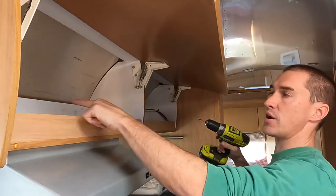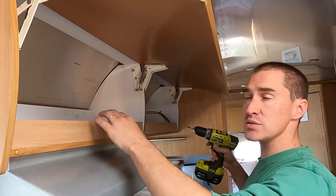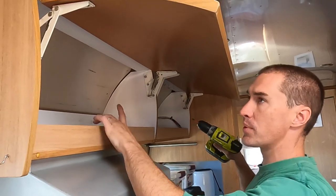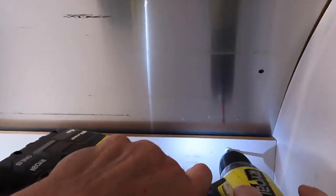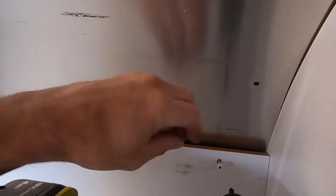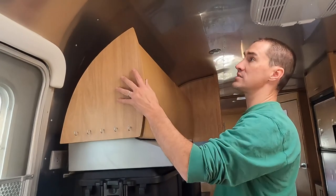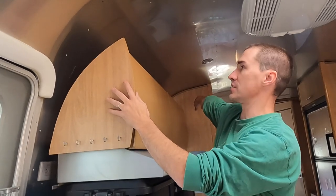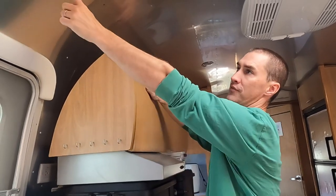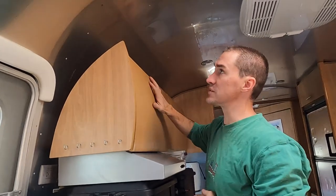I'm trying to get away with not undoing any electrical either. I can see 4 screws across the back and 4 screws attaching across the top. It's possible there are more screws I can't see, but I'm going to start with the first 8 that I can. There were no surprises — it really was just 8 screws holding it on, and there was nothing holding it to the next one over. So I've got my rivet line exposed and I'll be able to start drilling those out and replacing them.